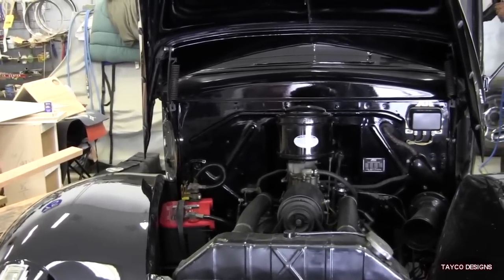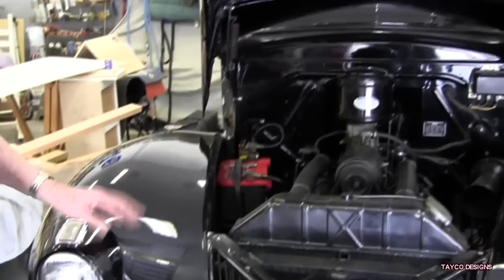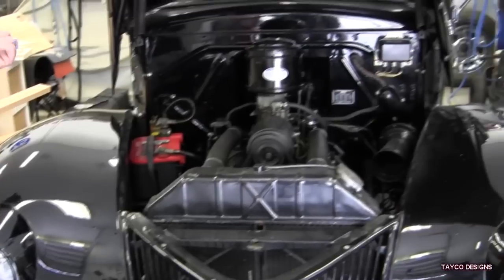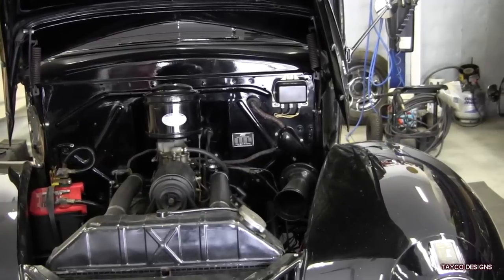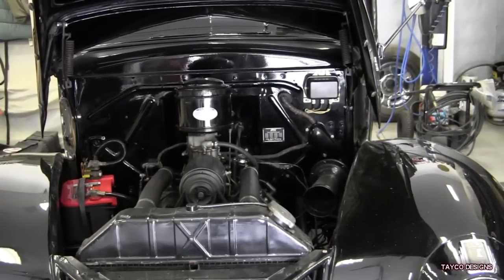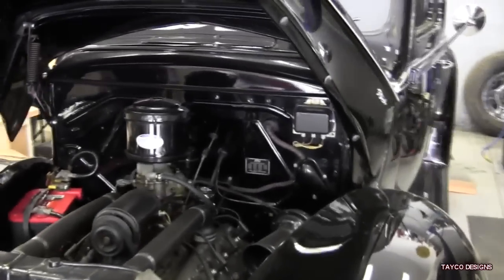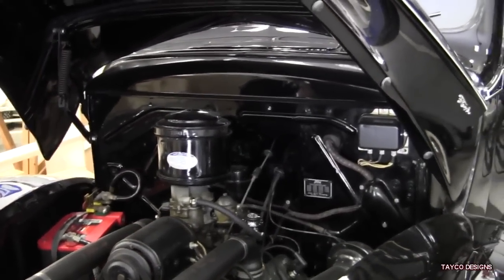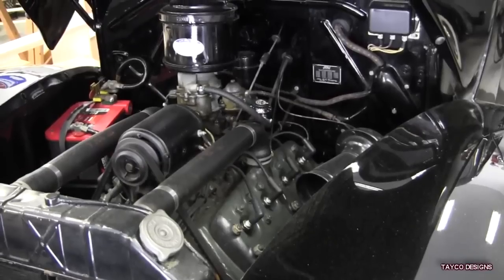And the cars in the 40s were the first year that they had sealed beams, and they also had hydraulic brakes. Before that, they came out with mechanical brakes. Hydraulic is what we have today. The motor was a flathead, water cooled, with all internal valves. There's no overhead valves on these. And 85 horsepower, and they were known to run real good, around 100 miles an hour if you could hold it. But so many of the roads were dirt or halfway paved, and you couldn't drive them very fast.